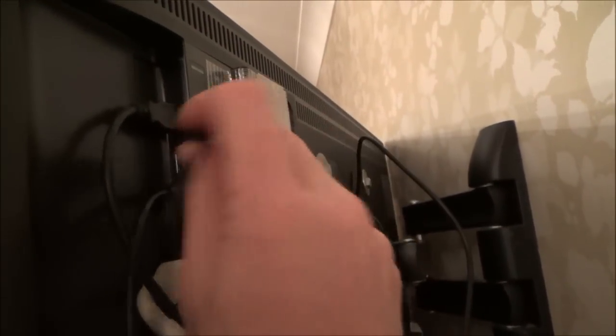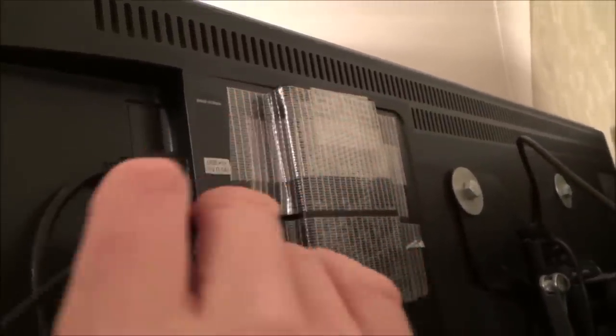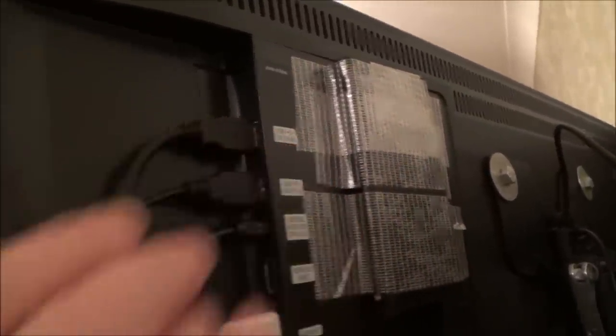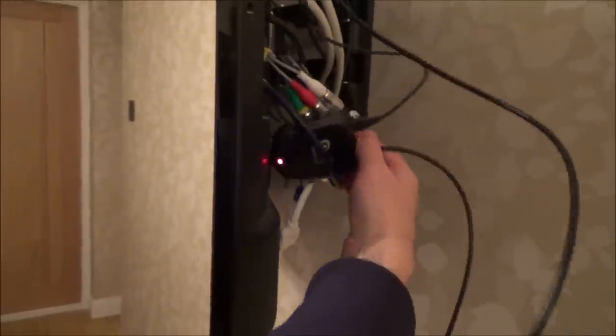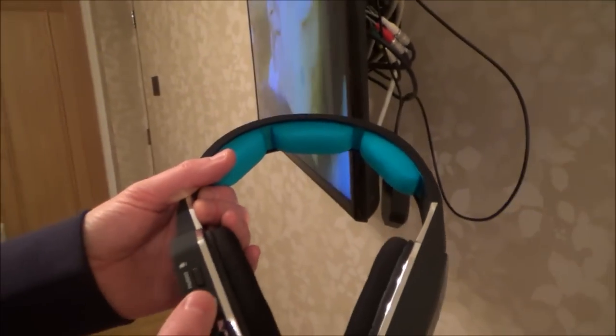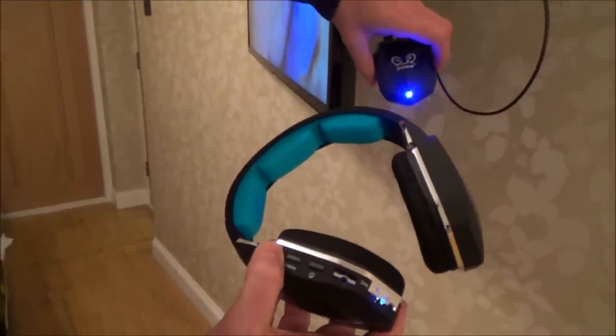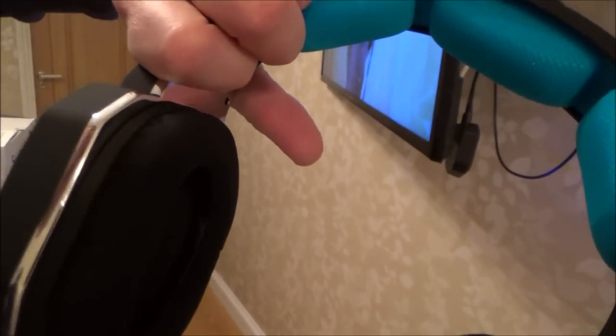At the back of the TV there's a port with a red glowing light labelled Digital Audio Out Optical — that's where we plug in the TOS link lead from the adapter. It only goes in one way. Then I give the unit power using one of the TV's USB ports — one outputs 1 amp, the other 0.5 amps, but it only draws what it needs so either works. Now I turn the headset on and it pairs up with the transmitter unit. I can already hear the sound coming through and adjust the volume.